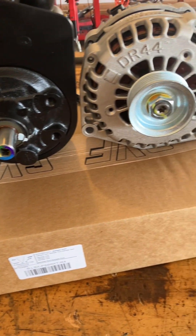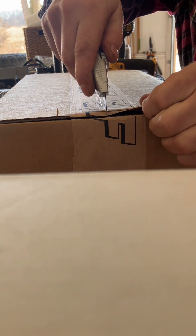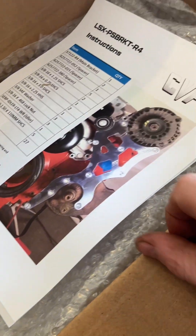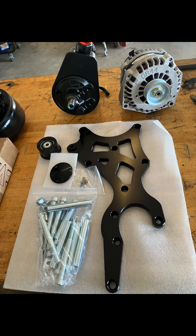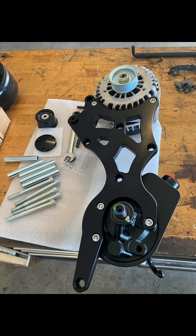I took a little video assembling all this — let me show you how I did everything step by step. First, get the alternator and power steering bracket box opened up and lay out the bracket and all the parts. The instructions are just one page and lay out all the spacers and bolt locations. The first thing I did was install the alternator and the power steering pump on the bracket and then tighten all those bolts down.